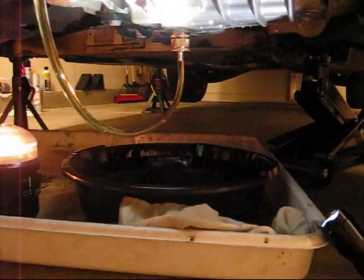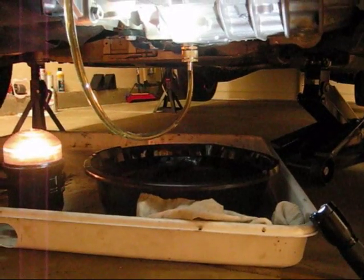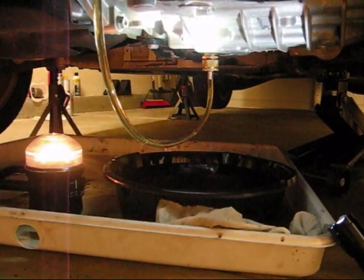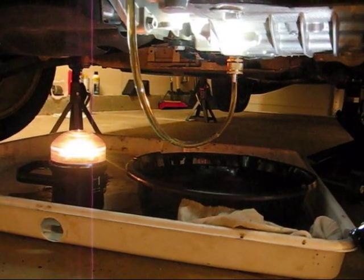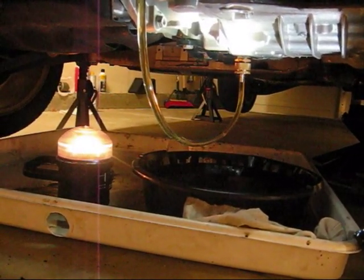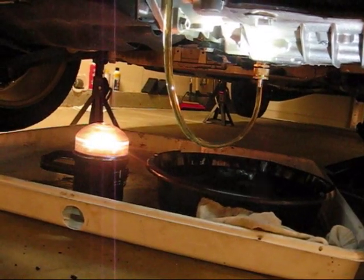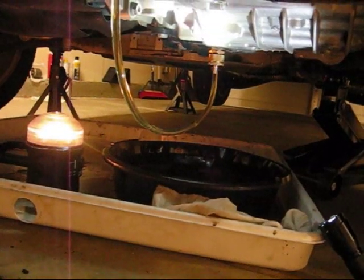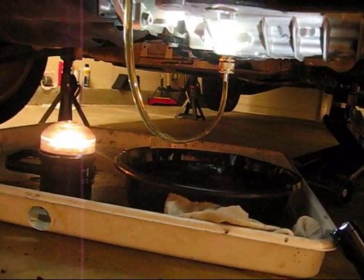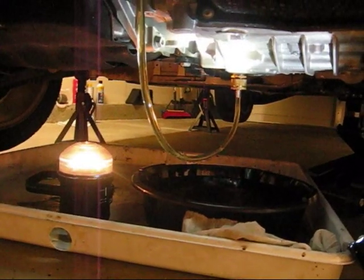That stays connected with a drip pan right below it. We're going to go ahead and turn the engine on and shift through each of the gears, holding for approximately three seconds at each gear, then return to park — all while holding down the brake pedal. Once that's done, we will immediately check the temperature of the DSG oil. When it is within the range of 35 to 45 degrees Celsius, we come down, remove the line, let the excess drain out, immediately remove the adapter, put the plug in, and torque it to 45 Newton meters — or 33 foot pounds.